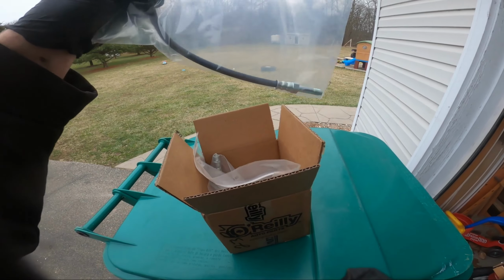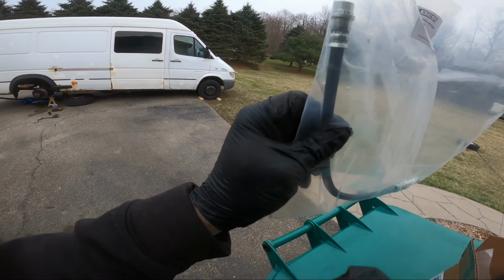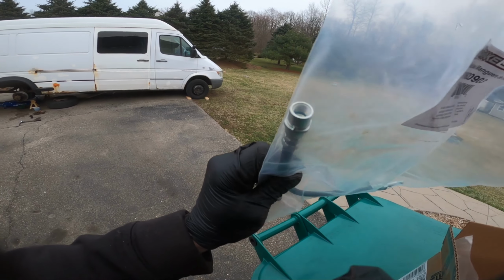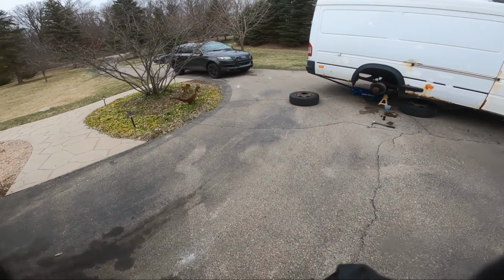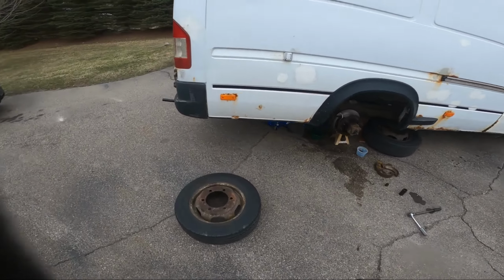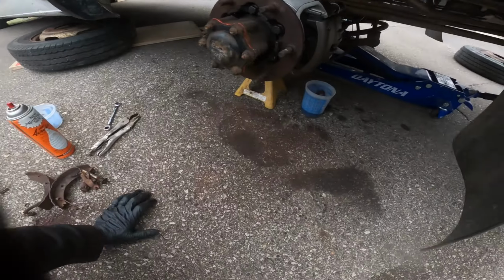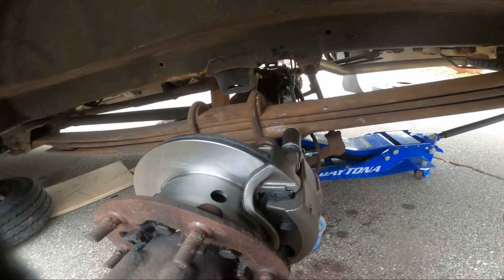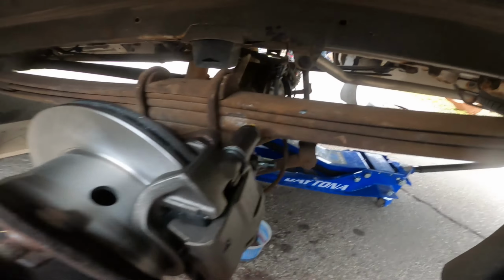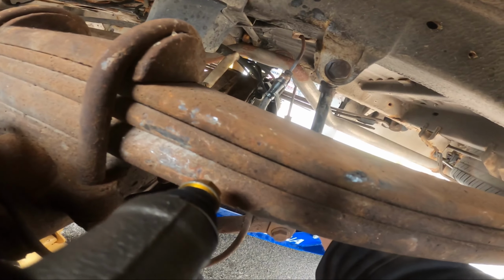Okay, so new rubber line, right? The way these go in, you screw this into the caliper first, and this goes up into the little spring clip, and the brake line threads into it, because the brake nut is supposed to spin on the brake line until it's tight. Well, I have this one loose, and it's not spinning on the line, because the copper nickel lines I was so excited about are not copper nickel lines, they're knockoffs from a horrible place. You can see there, they're super rusty. Turns out they're just copper nickel coated.